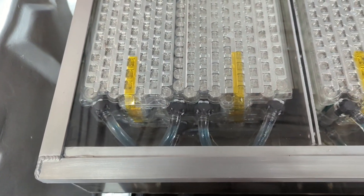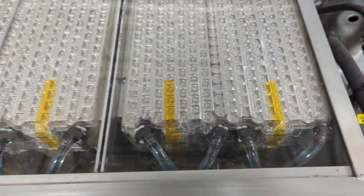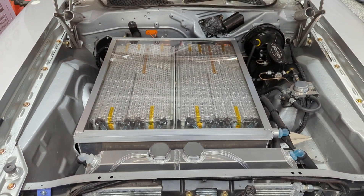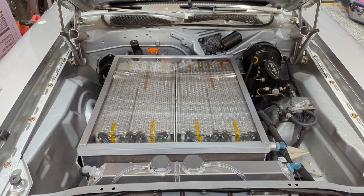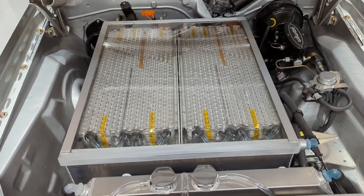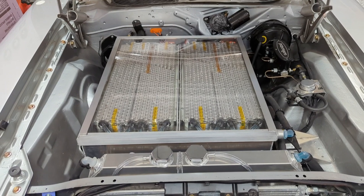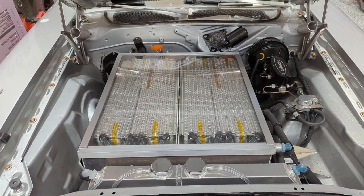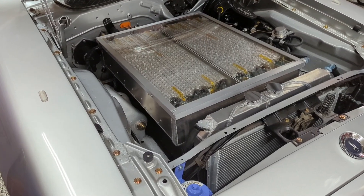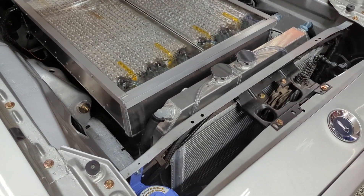The battery system is a little more complex — it's not just about cooling, they need to be completely thermally managed. There's a temperature range for discharge from negative 20°C to 60°C. Charging, on the other hand, is better done between 10°C and 45°C.